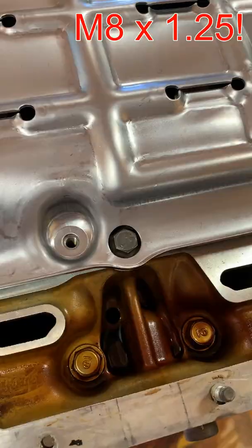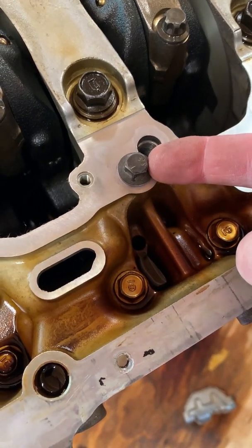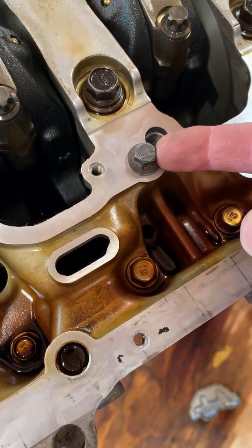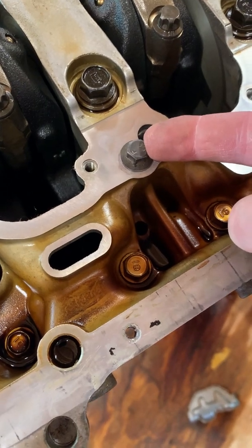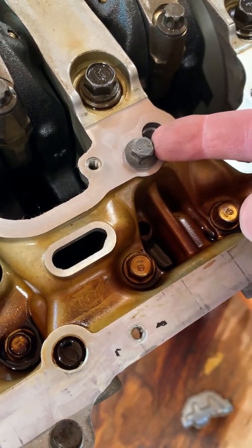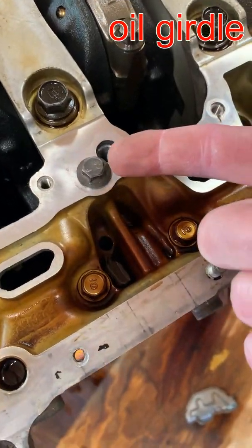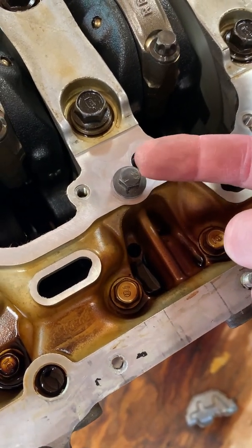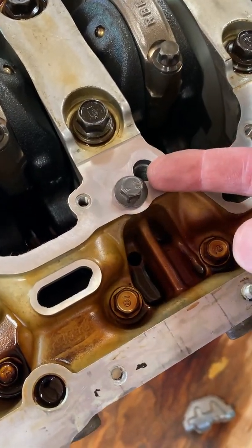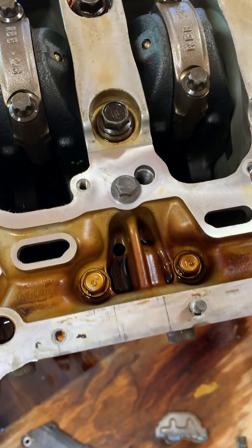The thread size will be in the description so you all have that. I'd also stay away from using a washer — it's a second piece of hardware down in the lower end of the engine, and there's something about having extra parts down here I don't like. With the pan head or flange head, one advantage is that even if the bolt were to come loose and back out a little bit, it's going to bottom out on that baffle and won't be able to get loose and potentially ruin your engine.